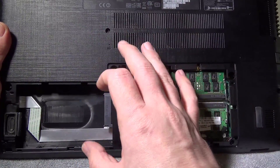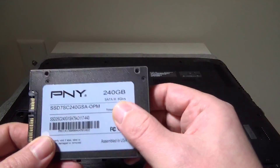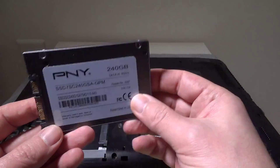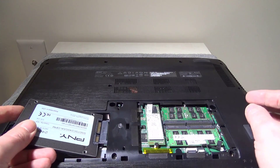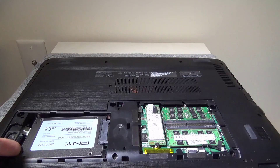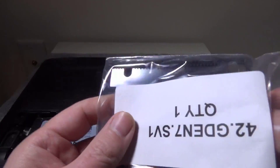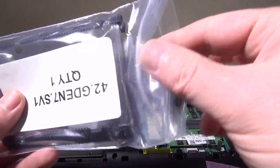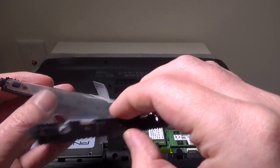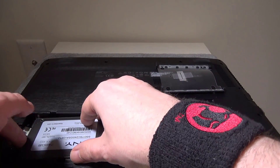It's very important to get this mounting kit, and I'll show you why in just a second. What we're going to be doing is using a PNY 240 gigabyte SSD drive, and I'm going to be adding that — I'll probably order a larger one since I'm enjoying the performance on this laptop. If you set the drive in by itself, you can see it wiggles around and moves, and that's what this kit takes care of. Over time it may wiggle out or rattle, but this kit with its nice Mylar tab will screw into the sides with the four screws and secure it in the bay the way we want.